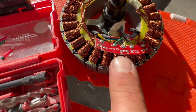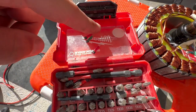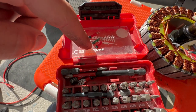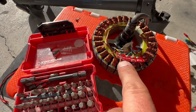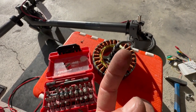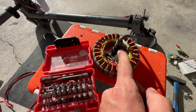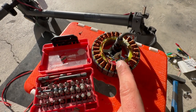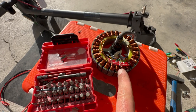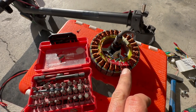So you have to measure it to be sure, because the middle sensor, the old one, is using a reversed polarity sensor. But in this case we will use the same polarity sensors. Just the middle one we will solder like the left and the right one, and after that we will turn it 180 degrees, so the letters of the middle one will be looking inside at the axial motor, and on the left and the right one the letters will be looking out towards you. Like this we have the three sensors working properly, the middle one with reversed polarity and the left and right one with normal polarity.